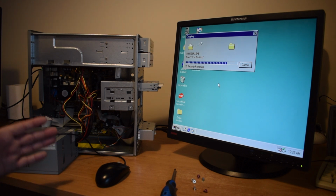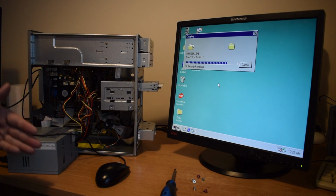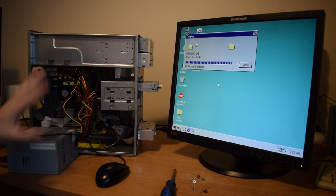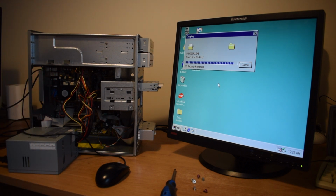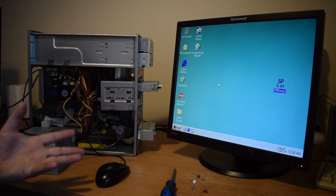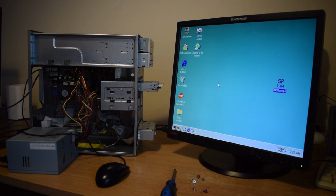I also noticed that if I shut down this computer, it doesn't appear that the ACPI, the bit that automatically powers down an ATX power supply, is working either. Now, I had that previously. Somebody told me it will probably be a setting in BIOS somewhere. Unfortunately, there are no settings in BIOS for this machine for anything to do with the power supply, how it behaves, etc.